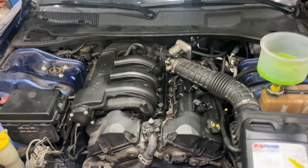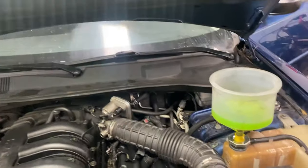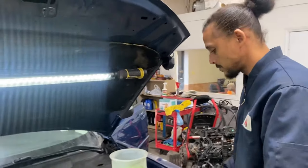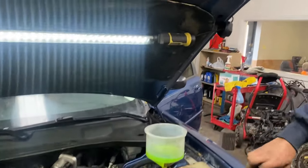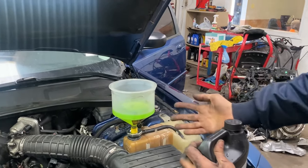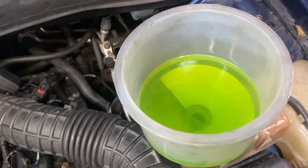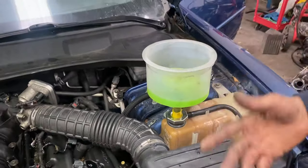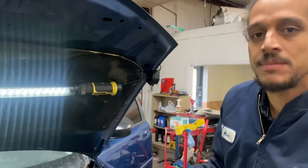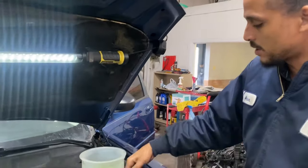If it has a heater control valve, you'll still have air in the heater core and you're going to have issues. So this next step is just a waiting game. If you have one of these funnels, great — you can just look at the bubbles and make sure it stops bubbling up. I think I already bled most of the air out of the system, but I'm doing it this way to double-check.